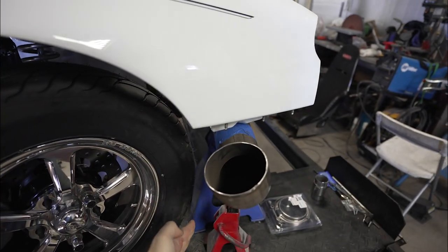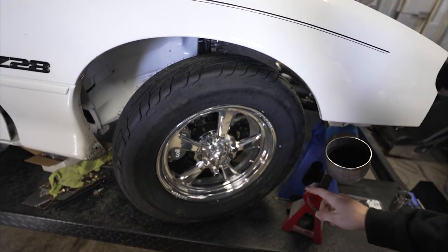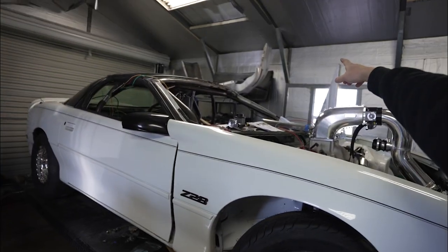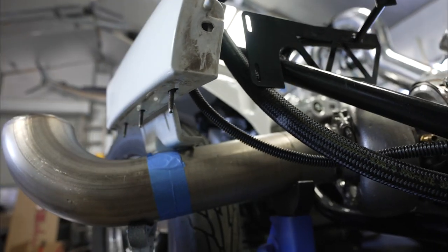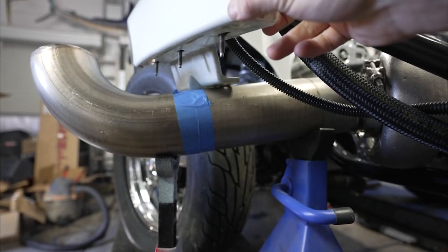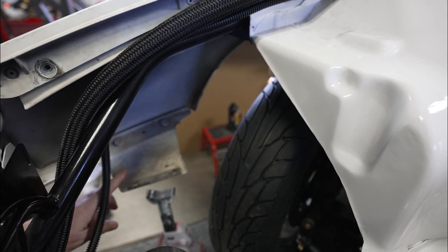I'm trying to shoot for being just inside the fender lip. I wanted to notch the bumper so I could slide the front end off if needed, but with the v-band, you just pop two v-bands and it comes off — not terrible. One of the first issues I'm running into is this little bracket right here, which I think used to hold the fog lights. It's actually for the inner fender, so I'm going to go ahead and cut it off and get that out of the way.